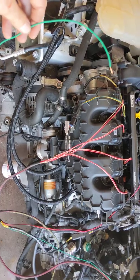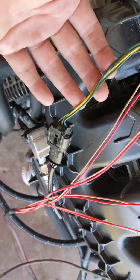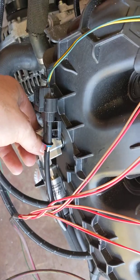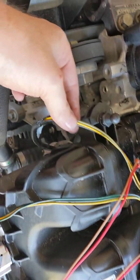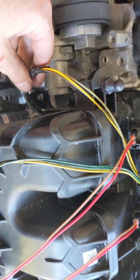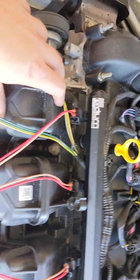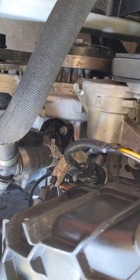So everything is a lot easier to get to for me. The harness that goes to the map sensor — this is a factory map sensor clip, this is a map sensor adapter, and we have a 5-bar map sensor from Dizzy Tuning. This harness is normally loomed up with the harness that goes to the high-pressure fuel rail pressure sensor. They had to be split because with the 4-port aux fuel rail in, the manifold sits further back and they wouldn't both reach.